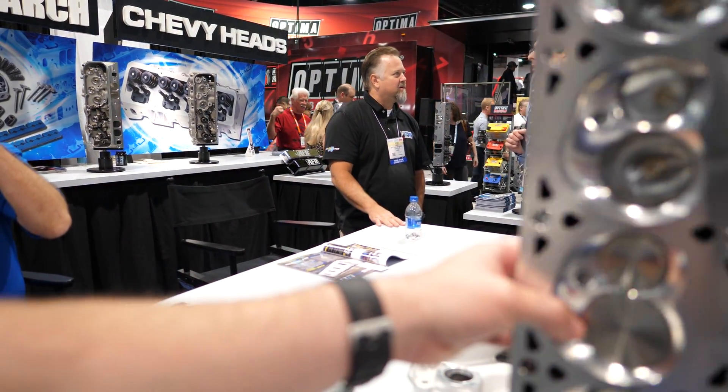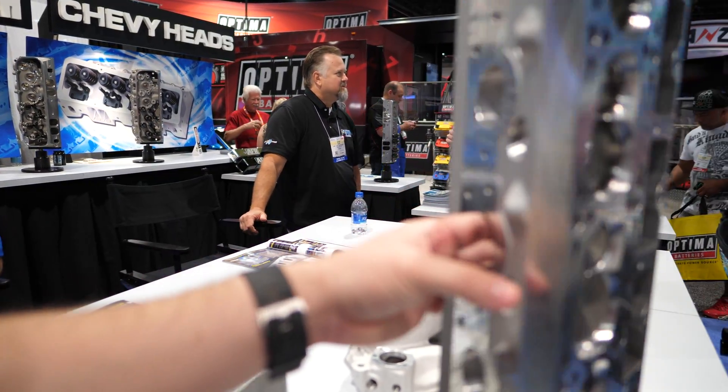I'm sure there's some gains just by it being smoothed out before the injector. No — you need the atomization, but you're not going to find anything if you polish it smooth. Pretty much the chamber and the exhaust port carbon up within a thousand miles anyway. The intake port — there are theories that it helps a little with atomization, like you said. They call it the boundary layer. With a CNC port the air is only hitting certain surfaces, not touching the rough spots. But it's all a lot of theory — that's what you guys are, Air Flow Research, so you've got the tools to test it.